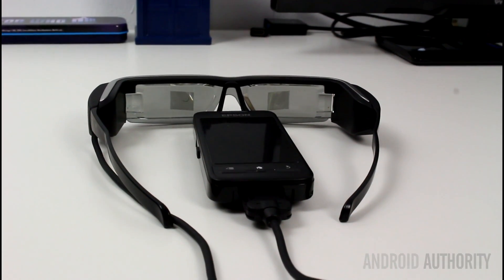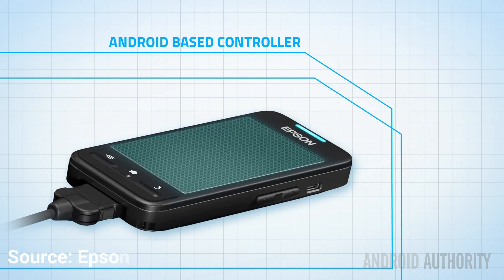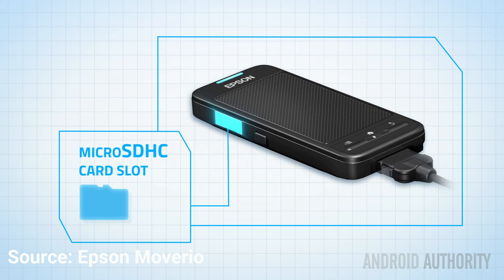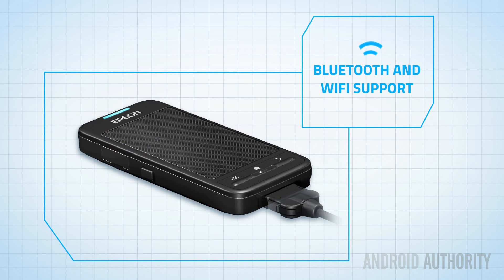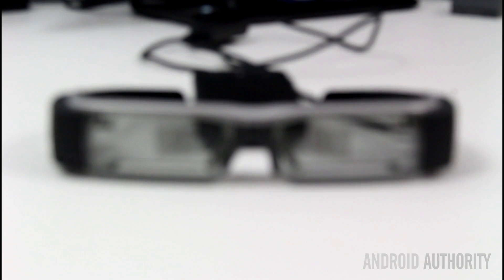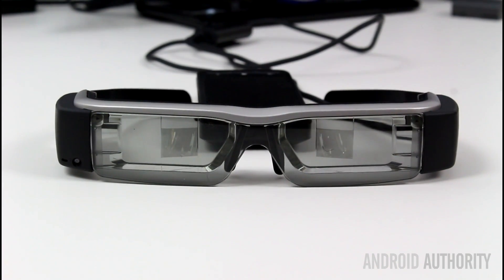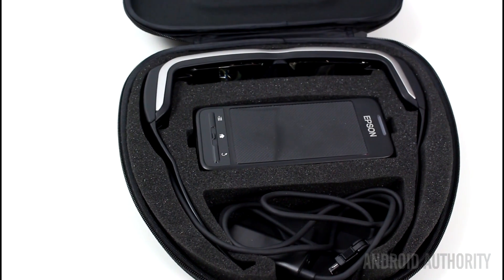Halfway along the cable is a small clip and a headphone socket. The control unit is like a small tablet, but the display has been removed and replaced with the projectors in the glasses. Inside the box is a Texas Instruments OMAP 4460 dual-core Cortex-A9-based processor running at 1.2 GHz. There's also 1 GB of RAM and 8 GB of internal storage, with micro SD card support for up to an extra 32 GB.